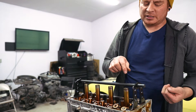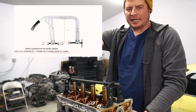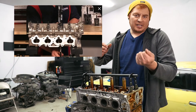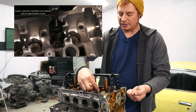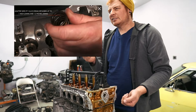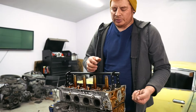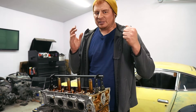There's actually another type of tool — kind of like a big C-clamp — that can compress the spring for you. One end goes on the valve face itself and the other presses on the spring. That one's easier in the sense that the clamp keeps it compressed for you without having to hold it by force. But with that tool the cylinder head has to be completely removed from the car and on a bench, which wasn't what I was looking for.